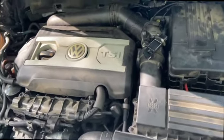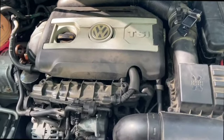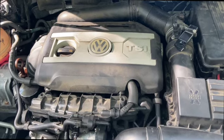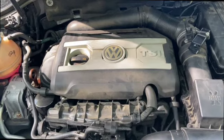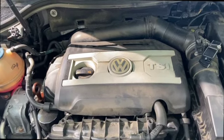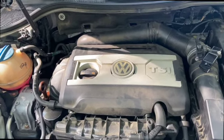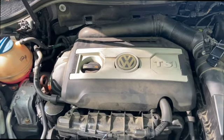I recently had in my engine on my Volkswagen CC a rather frustrating, though very interesting, problem. Under heavy acceleration or when throttle was required — for example maintaining speed up a hill — the car would make a jerking motion. It almost felt like a transmission issue, which came out after troubleshooting to be a misfire that would not even throw a code, it was that quick. Because I initially thought it was a transmission, I started paying close attention to it.